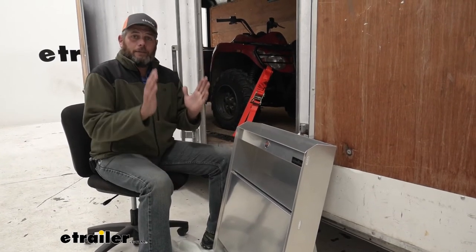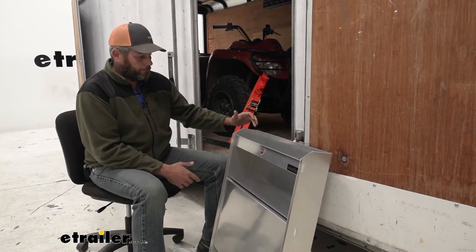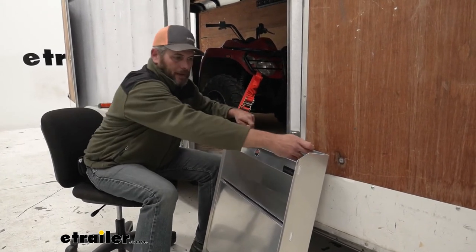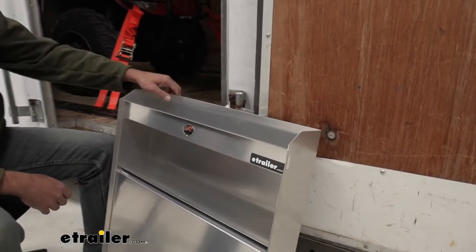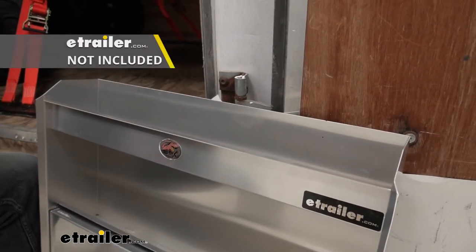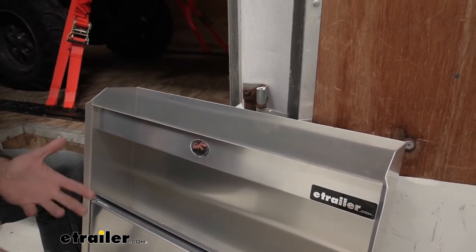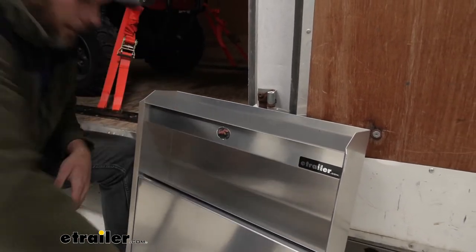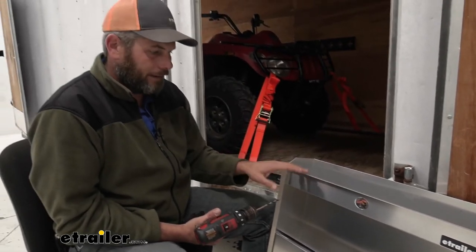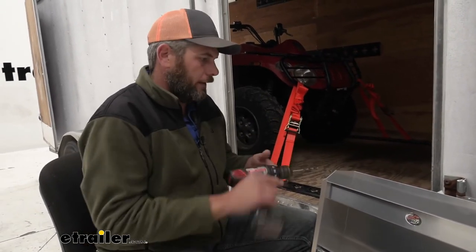We're going to be going in our enclosed trailer and its main support braces on the wall are 16 inches on center. So what I've done is measured the box inside to inside — it's basically 25 inches. I came off four and a half inches on each side to get us right down to the 16, and I marked my two locations. Now I'm going to be using number 12 self-tapping screws. We're going to put these in four locations — a couple up here and a couple down on the bottom to keep everything nice and secure. I'm going to drill these out first; even though a self-tapping screw will cut through there, I want to drill the pilot holes so I don't have any walking or anything like that.